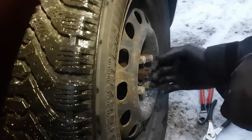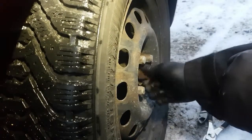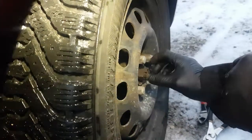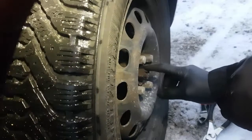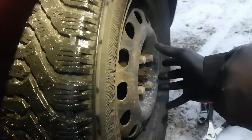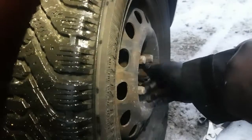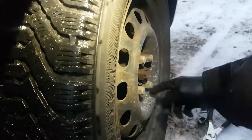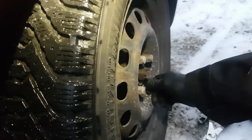The bearing is designed to give itself its own clearance when you tighten this up, so make sure when you put these together you tighten this nut right up. If you don't, the CV axle will turn the splines, and that can be a problem. It'll eventually wear the splines out, or it won't have proper clearance on the wheel bearing, and then you'll end up wearing the wheel bearing out quicker than it should be. So I'm gonna get the ratchet, we're gonna take the lug nuts off, I'm gonna jack the car, put a jack stand under it, and then we're gonna get started.